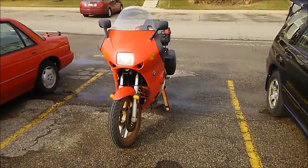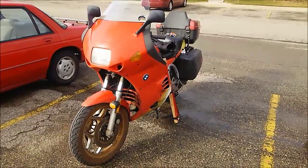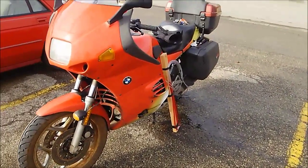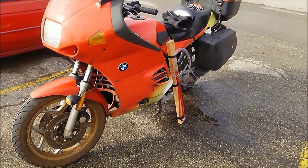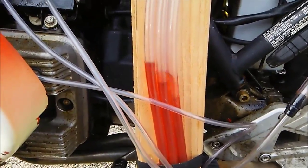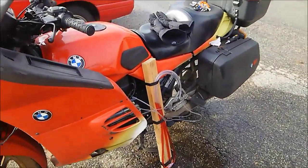All right Moto Brickers, this is my K75C and I'm experimenting with using transmission fluid in tubes versus using a real Carb Tune to sync the throttle bodies. I last adjusted this late last summer maybe, and I just got this adjusted so the bubbles are more or less bouncing at the same level. It's rather finicky to do it that way, but right there it's a whole lot better than it was.